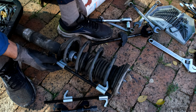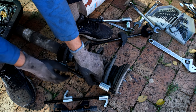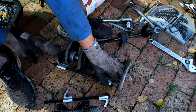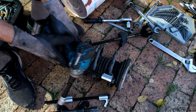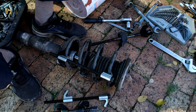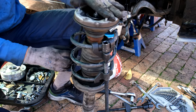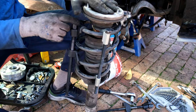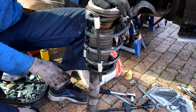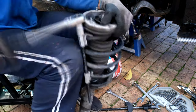I find the longest travel position — a very good position because I've got all the loops. I'm going to tighten from the top so the threaded rods go this way — there's more space. Do not use impact drivers when tightening these. I'm just doing an initial tighten to get them in place. I've got one here, one here, one here — I'm going to tighten these sequentially and slowly compress the coils. Don't worry about them being at an angle — that's fine. Remember: do not use an impact driver for this step.